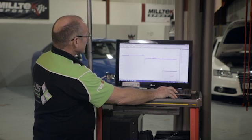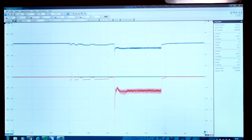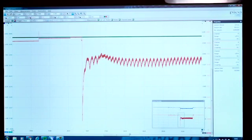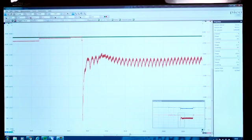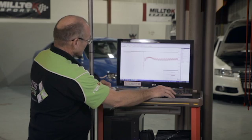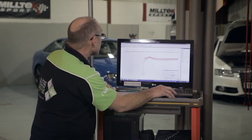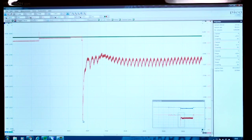Let's take a look at the consumer — the actual starter motor current. Let's use that tool and expand into this part of the image. You can see quite a dramatic consumption of current here. Let's measure the current. Peak current appears there — channel B: minus 917. Let's move up a touch — about there. 905 millivolts, which equals 905 amps. Note how quickly that decision can be made.